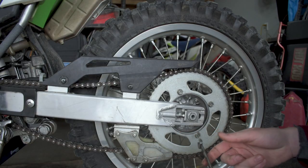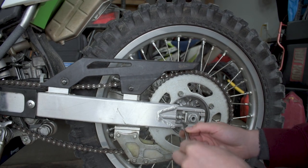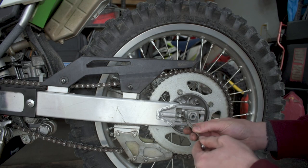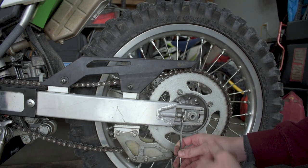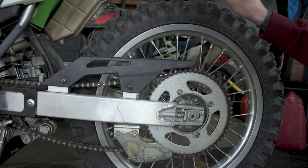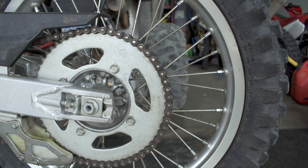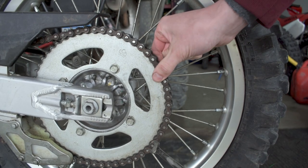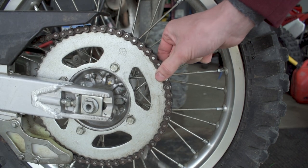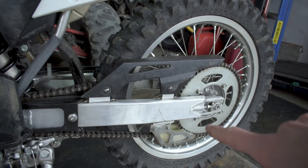My method is to do one adjustment on this side, then go to the other side and do one adjustment there, alternating back and forth until the chain is no longer loose. An easy way to check: if you can pull the chain and watch it move all around the sprocket, it's still way too loose. You do not want to be able to lift the chain and have it flop around the sprocket. Keep tightening until that's gone.